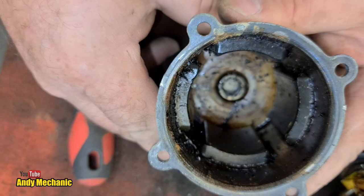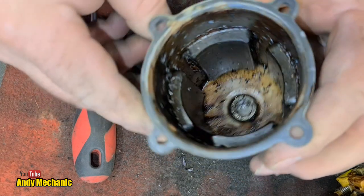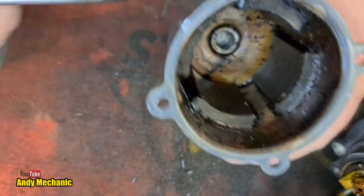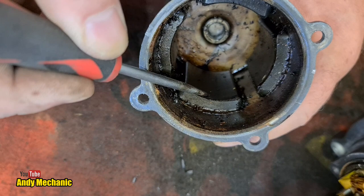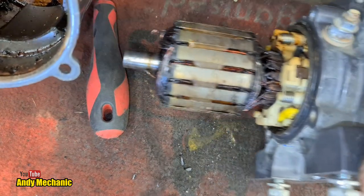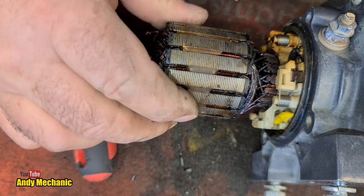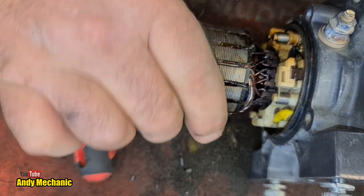It's pretty bad down there, isn't it? Let's see if I can get it to focus for you. There you go, look. Pretty bad. And it really stinks. It really, really does. Where's autofocus? There we are. Yeah, so not so good, but if it got really, really hot, I've seen it where the glue holding the magnet to the actual casing fails, and the magnet becomes loose, it dislodges, and then you get what's called poling on the armature, where the magnet rubs against the armature casing here, look, and you get rub marks and it really turns to shit, to be honest. It's really bad. One thing I have noticed is this motor is quite hard to turn.